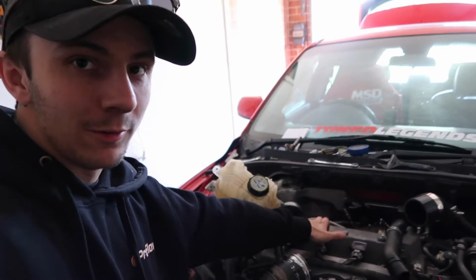But I bought a paint to do my rocker cover in. The intake will also be the same color. I'm going to go to the back, put the battery just sitting in there, and see where the terminals are and whatnot. The other one's already lugged, so that's fine, the ground. And just see where I'm going to put that inline fuse, and then put the tail to the other crimp lug that I've got for the battery terminal. And then we should be all Gucci gang.